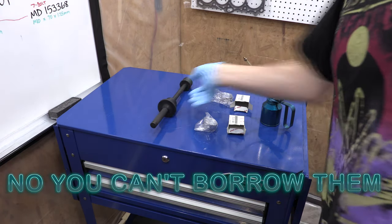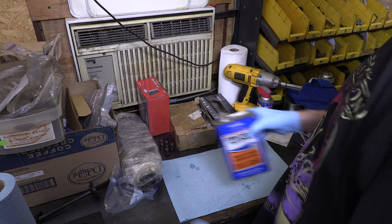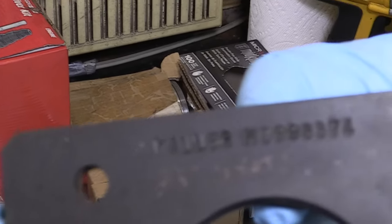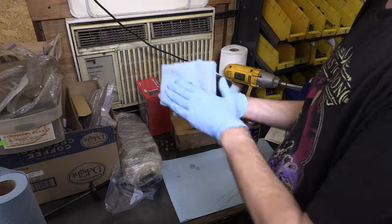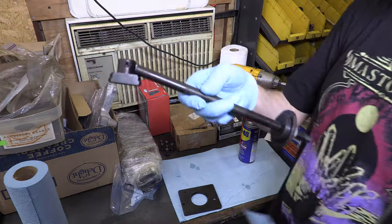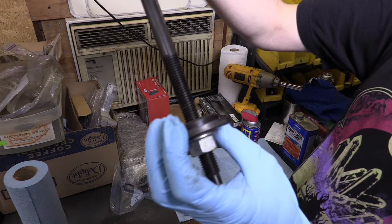But the driver can't do all three bearings all by itself. The left shaft requires a plate that bolts to the front of the block. That's a plate that I also have. It's needed for the left shaft, whether you're installing or removing that bearing. With this plate and the driver, you gain the ability to drive in all three bearings. But what about removing them? I also have the factory balance shaft bearing puller, which we'll use someday when I get to the Gallant.